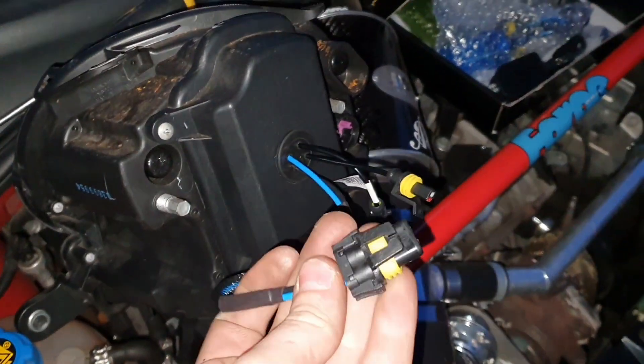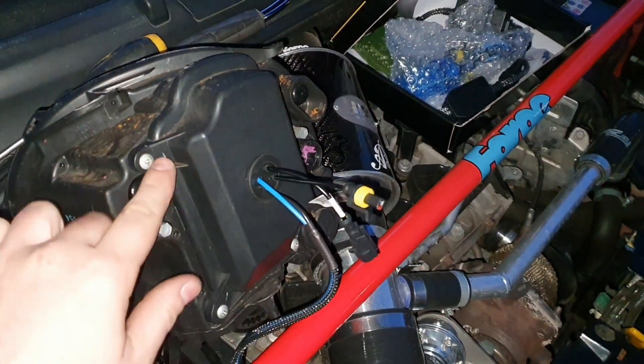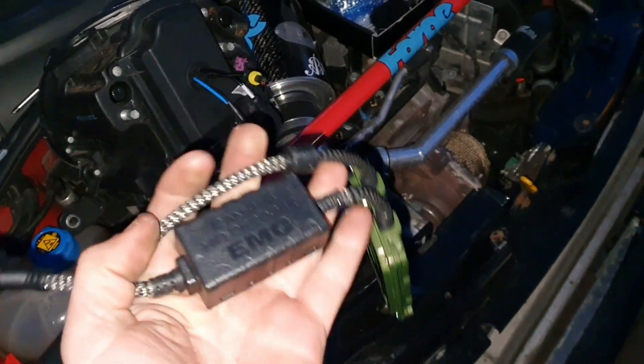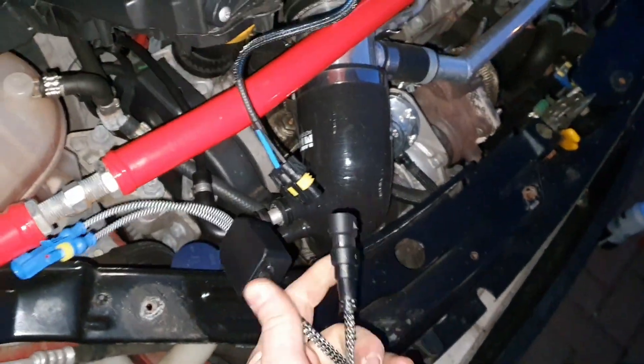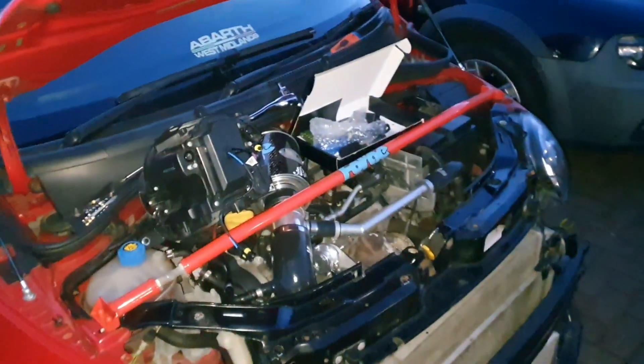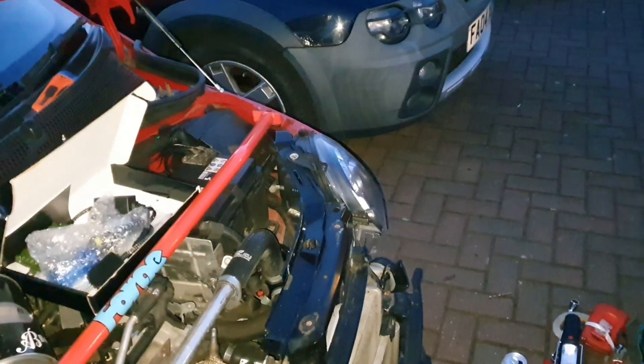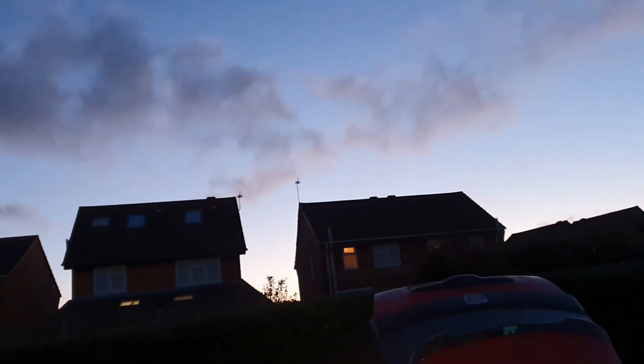We've now got this plumbed in - it is going dark. We've got the light on and three wires coming out. The connectors are all in and tightened up. Now we have our ballast - the green ballast. You just want to plug this plug to that plug, the yellows go with the female connectors and the males. Then it's just about putting your bumper back together and plugging in the brown cable back into your headlights.